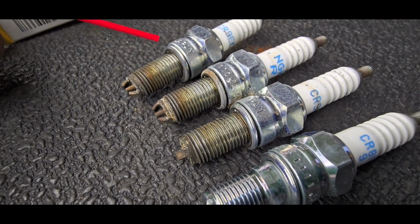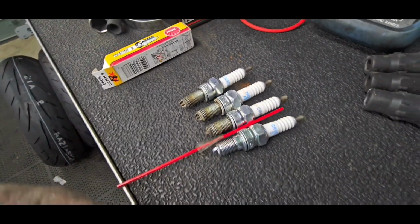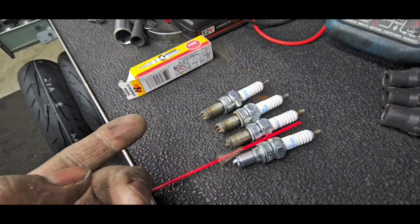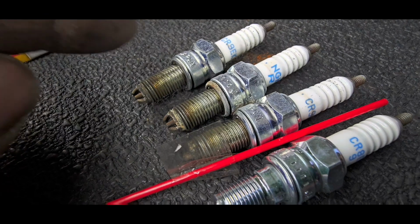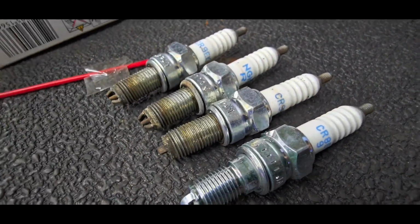So I'm just going to say that the previous technician was either A, lazy, and we could kind of affirm this because he didn't even put the hose clamps on, or B, is an apprentice, which is very suspicious because none of these crush washers are crushed. And there really isn't a C or a 3. It's just going to be those 2.